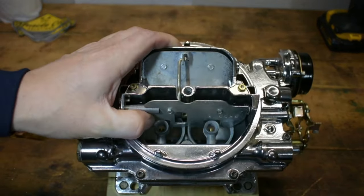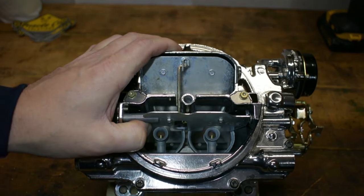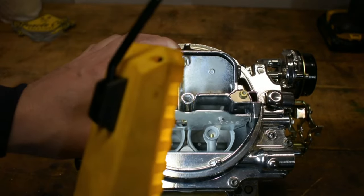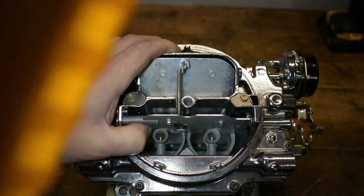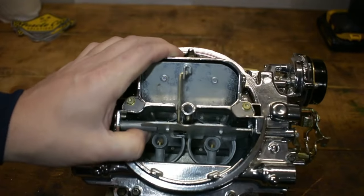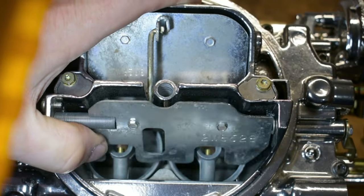That's key. The door is designed to open against a little bit of spring pressure, and that's what you can adjust to get the right amount of pressure going through those venturis. You're adjusting the tip-in of that air valve to flow over the secondaries.